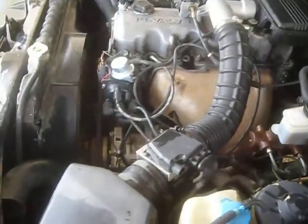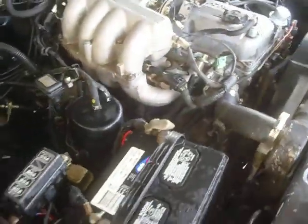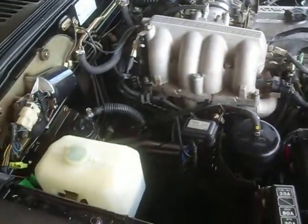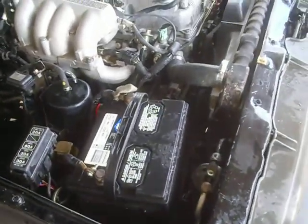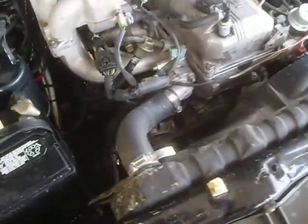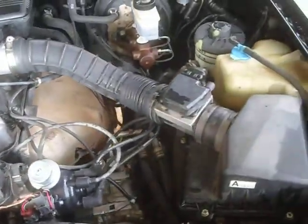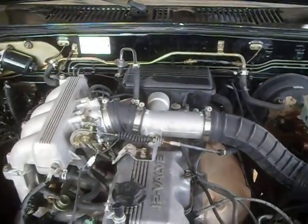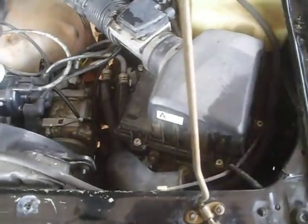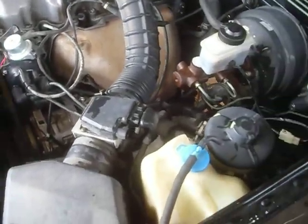As you can see, I've got it running. The problem I had was when I was putting the distributor in, I was putting in a tooth off. I messed it off a little bit and figured it out. Some guys over at Mazda Truckin' were a big help — gave me some pointers, told me things were what they were. So yeah, it runs.